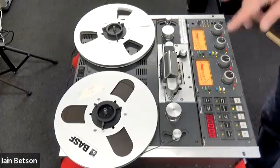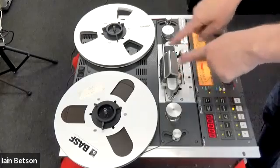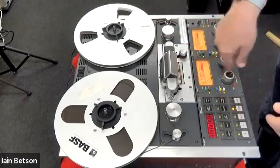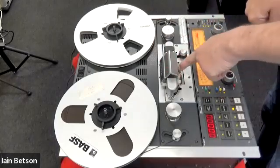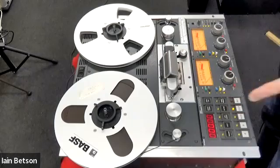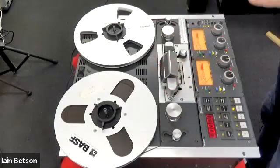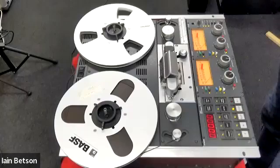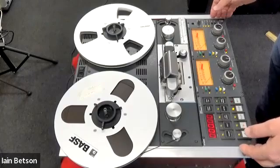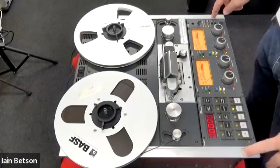The lifter button — I wouldn't recommend you use that. There are two tape lifters on the head block which lift the tape off the heads during rewind or fast forward. Pressing this lifter button releases the lifter and the tape goes against the head, so you can hear the tape chattering at high speed and hear where you are on the tape. The downside is head wear. Use it if you want to hear the audio, but I don't recommend it on a daily basis.